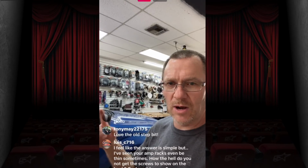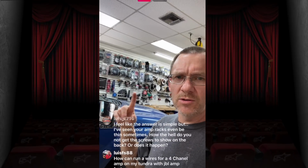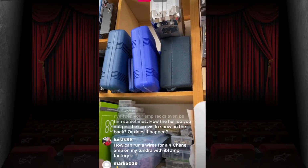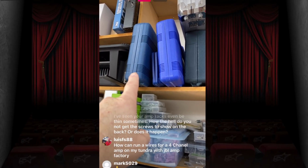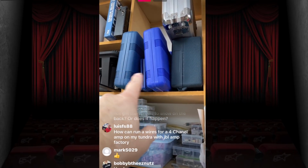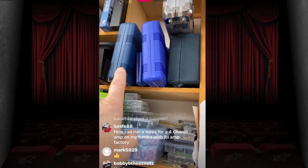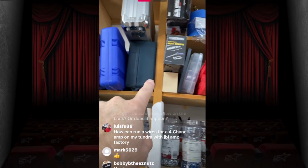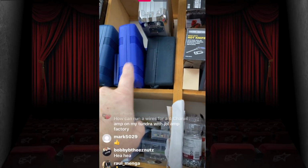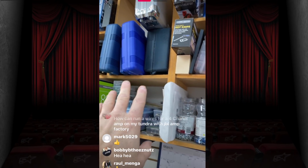Like you guys have always seen these routers up on the wall. Though we don't build a lot of custom fab anymore, each one of those has its own bit in it, and they all do a specific thing. Up here, like the rivets, we use a ton of rivets. So this one has an M5 in it. This one hasn't. Actually, this is the M5. This is the M6 rivet head that we use, so we don't have to sit there. And those are the two size rivets we use. We use M5s the most. So that's an M5, that's an M5, that's an M5, and the Air one is an M5. But we use M6s for license plates and oddball stuff like that. So we have just a tool to do M6s. Yep.